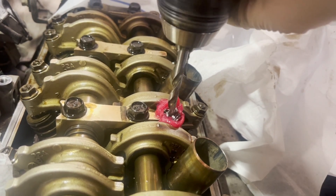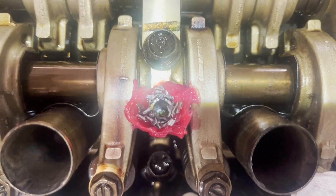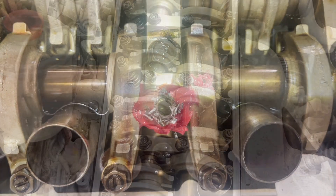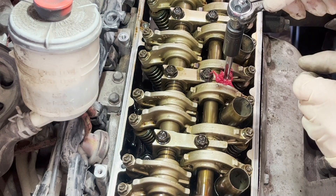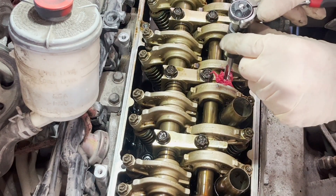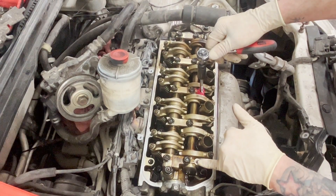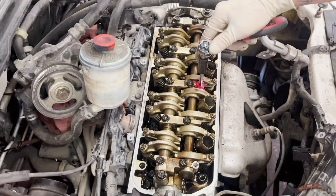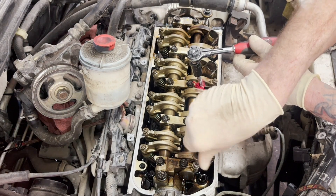Don't go hog wild. We got to catch all those filings — we didn't have to tape off the whole area around it. We saved this thing from having any more engine trouble. Go ahead and lube this up with some cutting oil. As you go to do this, it's easy to get it cocked. Most of the time it's going to want to follow the hole. Look at the other bolt holes and see if they're facing kind of straight up and down or at an angle. What I did was put one of the other bolts in to see what angle it was at, to make sure I'm doing the same appropriate angle.